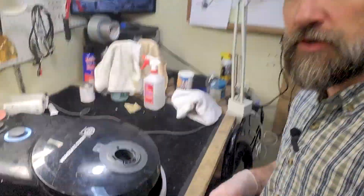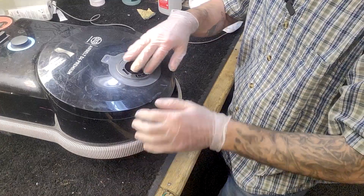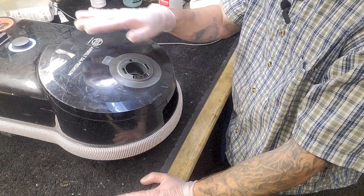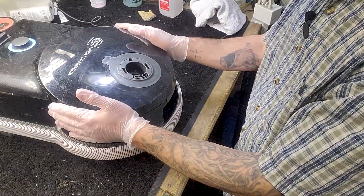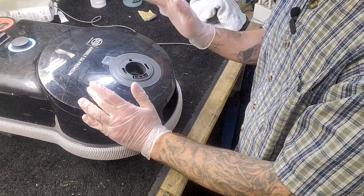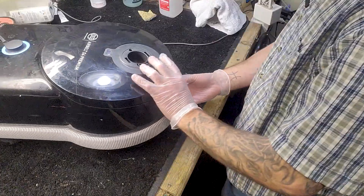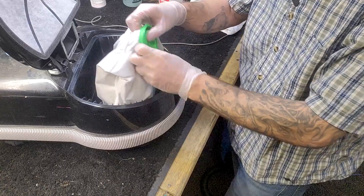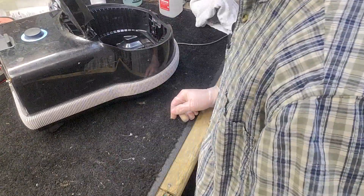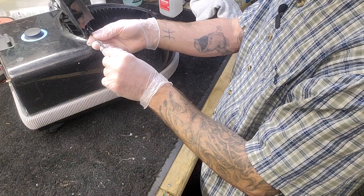The actual issue we're dealing with is the wire inside the swivel neck here. These swivel, so the wires feed electricity up to the neck and into the hose — they move back and forth and can eventually break. This machine has the absolute best swivel neck design I've ever seen, but nothing's perfect and it can still fail. I'll walk you through how to pull this off. The tabs are very fragile, so if you're a service center, it's not a bad idea to keep one of these lids in stock. There is also a service manual created by Lenny prior to his retirement that is marked for internal and dealer use only — I won't be sharing that, as it would risk our dealership, but I will walk you through what's covered in it.